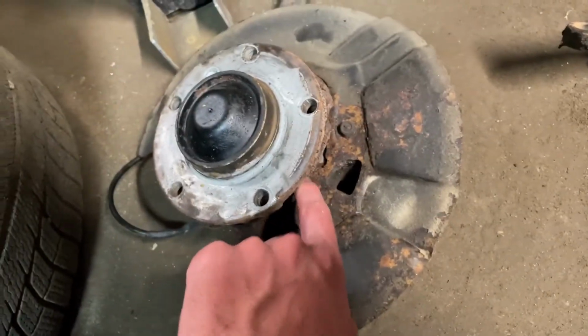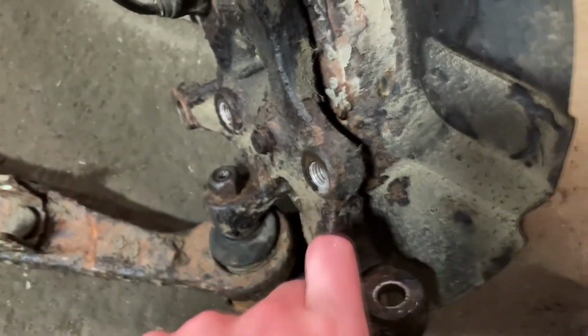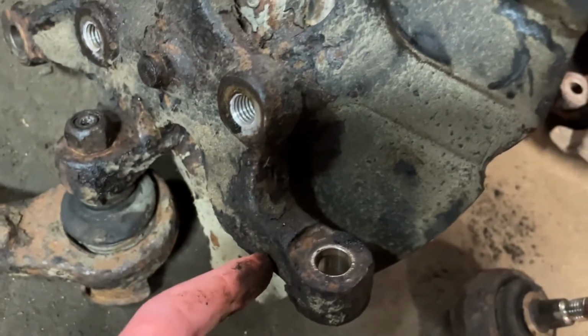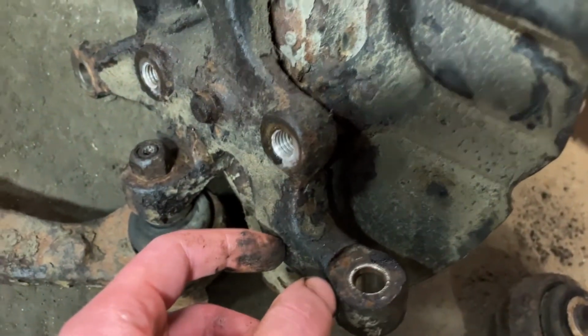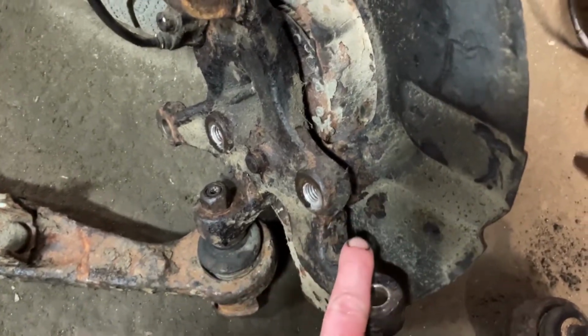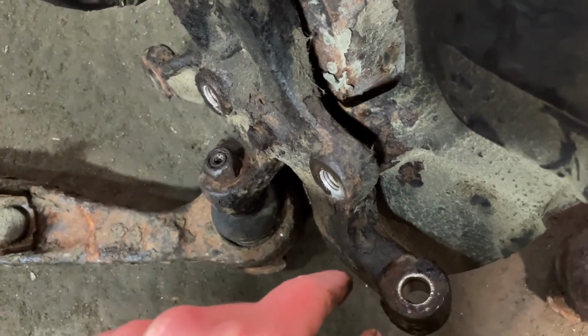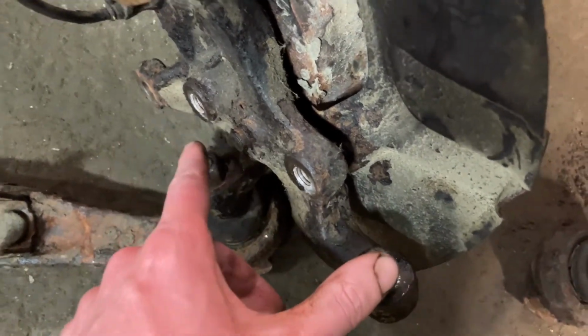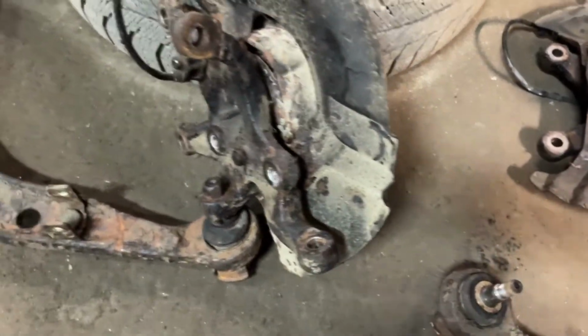But yeah, pop the hubs off, get new front wheel bearings, new front hubs, chop it off here, and then move this in to here. And I think I'm gonna mess with the Ackerman a little and get this section pulled out to about here instead of in here, so you get an inline setting there and a much more neutral Ackerman feel.